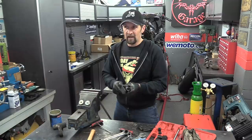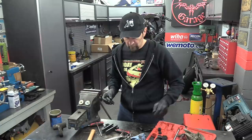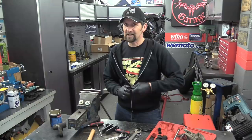And as I've said many times, I seriously believe that things like wheel bearings and swing arm bearings should be a long-term consumable service item, meaning that after maybe 10 years, they just get replaced as a matter of course, because as you've seen yourself, you can't see what's going on inside that bearing when it's on the bike. And often, like the wheel bearings, you can't see what state they're in until you rip them out, by which time they're knackered anyway. Because you can't inspect them, they absolutely should be a service item. But hey, no one's listening.